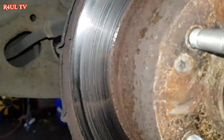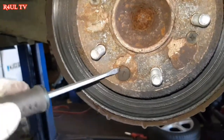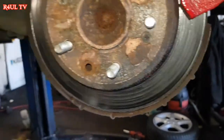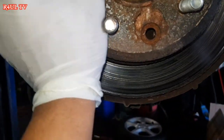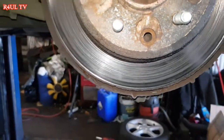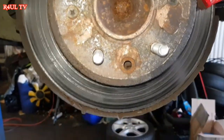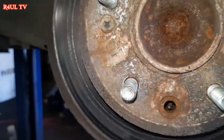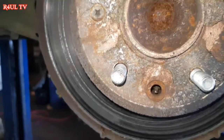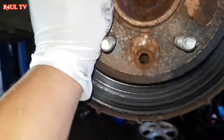Then we're going to take this rubber grommet or rubber cover off — take that off. And you need to find the handbrake adjuster, which is right there at about six o'clock. The adjuster is in there — that little notch. I'm in the UK, so on the passenger side rear, you go down to loosen it and up to tighten it. The driver's side might be the opposite. I've slackened it — you can see it's all free now.